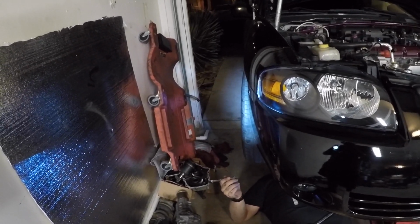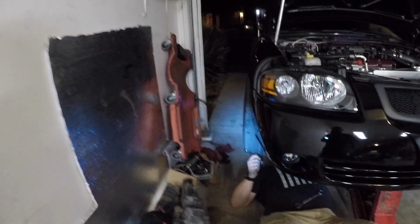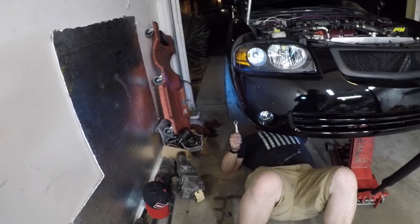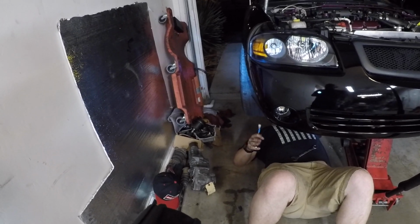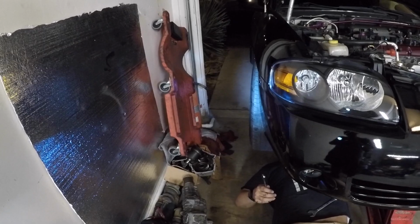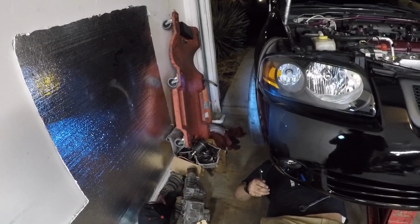Yeah, on the inside. I think these tie rods are just longer. That's freaking weird. I think they are. They have to be. Unless I'm mistaken, but I want to say on the stock rack with the bump steer, or with OEM, I had a very similar amount of threads left and right side to be the same toe set. But I may be completely mistaken as well. I'm going off memory from 3 years ago. Dinosaur ages, right? How close are we? You still got some time. Wow, I'm bringing this way the fuck out.